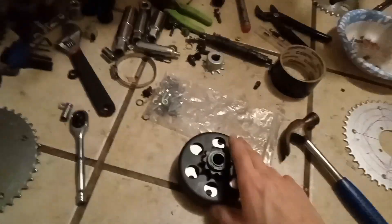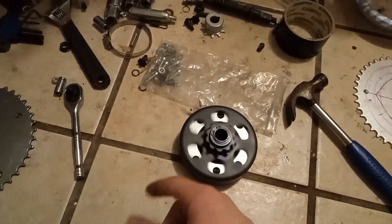I got a new clutch which is going to go on a new axle. The problem is that this gear comes too far out from this, and this is its original position where I had cut this down so the one I had would be further in so that this chain could go on here without hitting this. Now this is going to be fully out, and what we're going to do is have one gear on both sides.